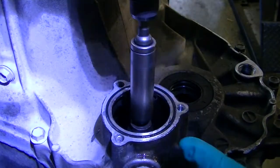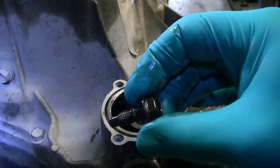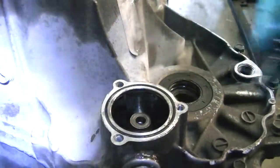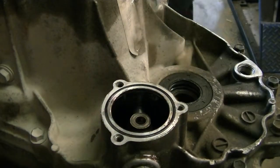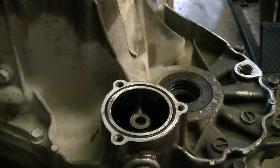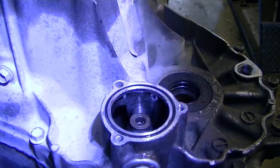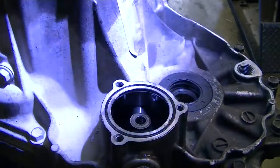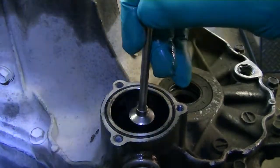I'm going to break that 12mm loose — that's what it looks like — it just drops in there. Pulling it out, I like to use a magnet so you don't lose it and drop it into the transmission. Obviously this tranny is on its side; if you're doing this in the car it's a lot less likely to drop in because instead of pointing up it would be at a 90-degree point to the side. But definitely use a magnet — simply place a magnet on there where the bolt was.